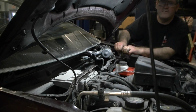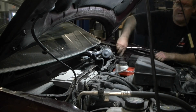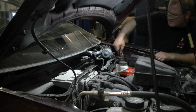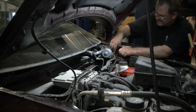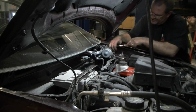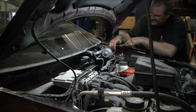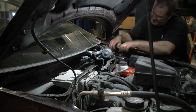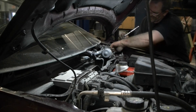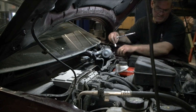Alright folks, 13mm. And I could use the power tools to do this, but what the heck. Let's do this the home way. Get these off of here. Remember, what we want to do is make sure that we don't take all of them off. We want to leave one slightly attached so when we drop things, we don't end up dropping it down accidentally. So, once you get them loose, they're pretty tight, they're locking all the way through.